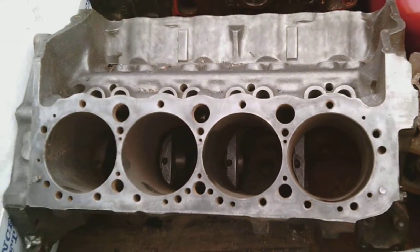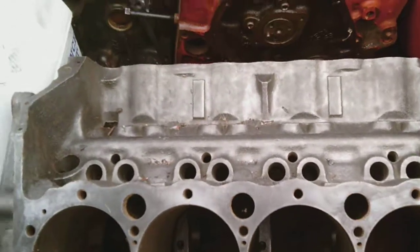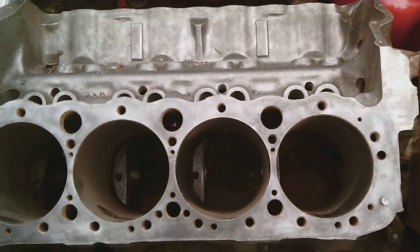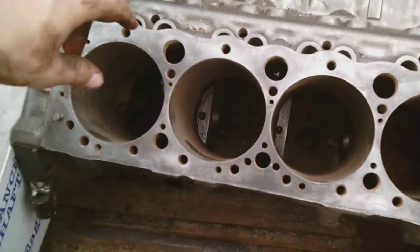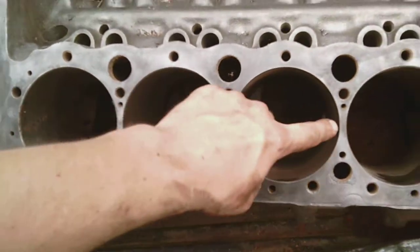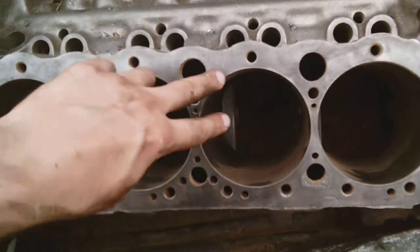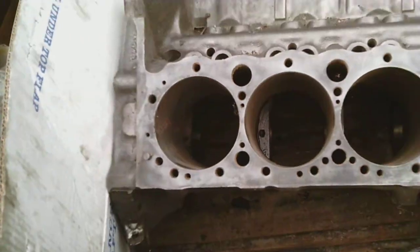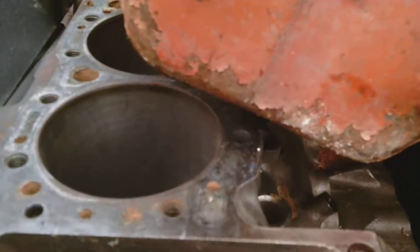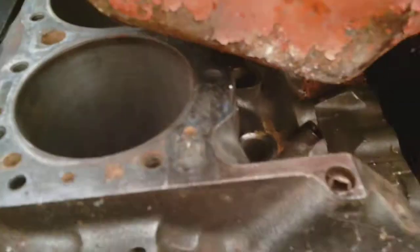This is a Chevy 400 block. It's the biggest small block Chevy, traditional one. I think these are from maybe 1970 to 1980, and the 3/4 ton vans had it. But you can tell it's a 400 block because see, it has these 2 little holes between each of the cylinders here, and the 350s don't have that. So, well, here's a good example. That's a 350 Chevy and see it doesn't have those holes there. See, this one has it? No, it doesn't.